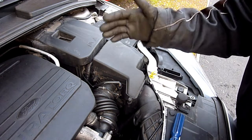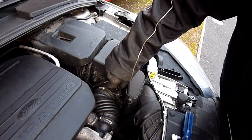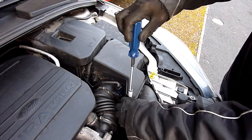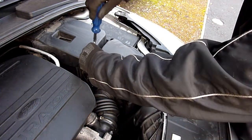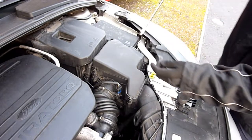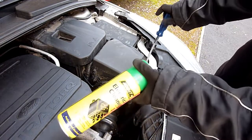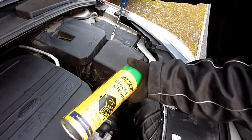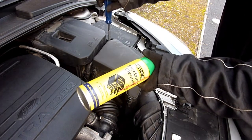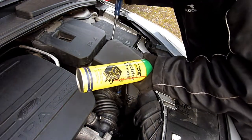I must have taken it off before, but I am also going to be changing the oil filter in another video, so I don't mind taking it all apart just to get it. Let's unplug it first so we don't strain it. One of these springy screwdrivers with 7mm ends are really useful. I forgot to mention — you do need a low residue or no residue electrical cleaner. To clean something like a MAF sensor you need something that doesn't leave any residue, but it's liquid and a bit of a solvent, and it just disperses any kind of carbon build-up on there.